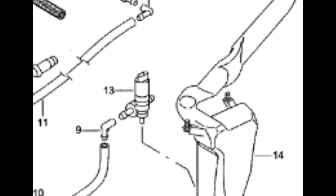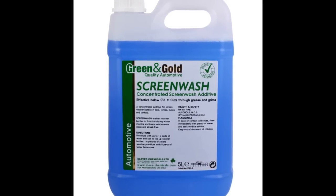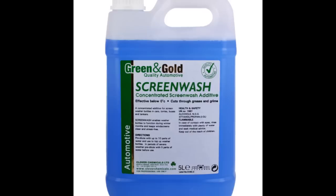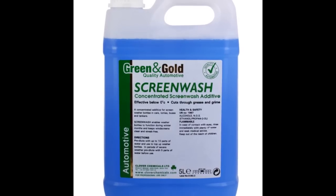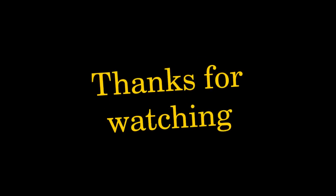So hopefully that's cured the problem. To prevent these pipes from freezing and popping off, I would recommend that you run your car with a very high concentrated screen wash — probably around 50-50 in the coldest part of the winter. That's what I've done since I've had trouble with mine and it's been fine since. Check out some of my other videos which have got other Ibiza tips and fixes, and I'll put a link down in the description to the Ibiza forum for this particular fix. Cheers for watching and I'll catch you next time. Bye.